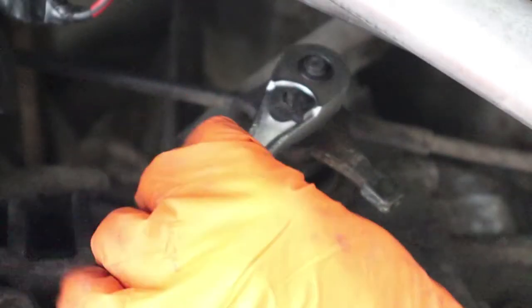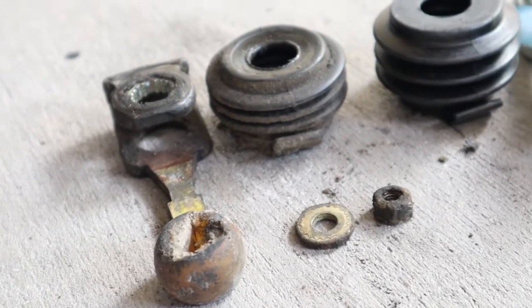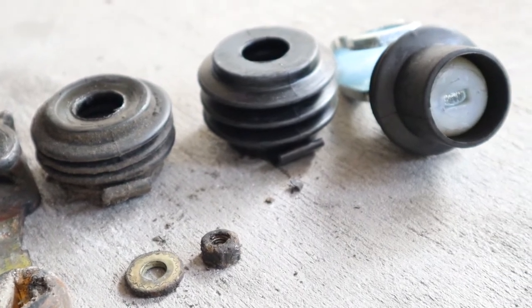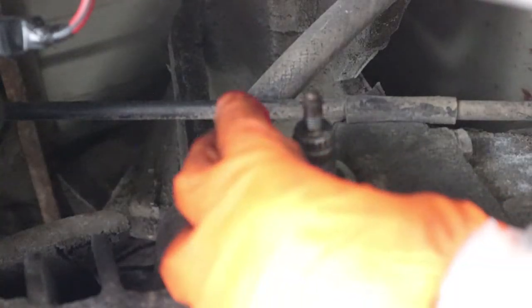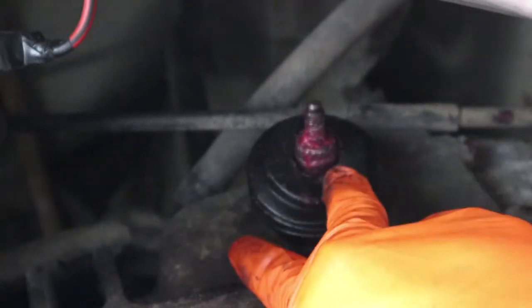Next, I moved my attention to the shift lever still attached to the transmission. I made sure the car was in neutral before I actually pulled the lever off. I've taken the old shift mechanism off of the transmission, and now I'm going to apply a little bit of grease to that little shaft and put in the new boot and the new shift lever. I'm not going to grease it up too much just since the other parts haven't arrived yet — I don't want a bunch of grease out here collecting dust. I looked everywhere online for torque specs and the type of grease to use, but the general consensus was that torque is not very important and the type of grease didn't matter much either. I used some high temp general purpose grease I had lying around the garage.